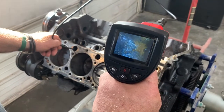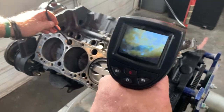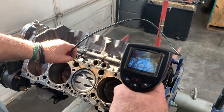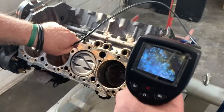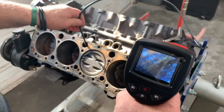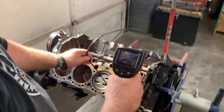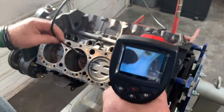Like an aluminum, like an LS application or any kind of aluminum performance type engine, these would all be super smooth surfaces, so there'd be no friction, there'd be free flow. Coolant flows freely, you don't get all the stuff sticking to the walls, because everywhere you're getting stuff sticking to the walls, it cuts down on the cooling efficiency. So in a performance application, they eliminate all that kind of stuff.